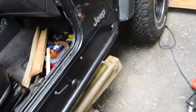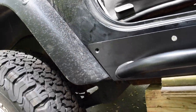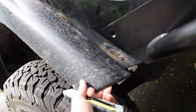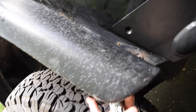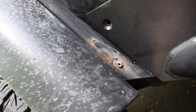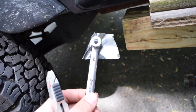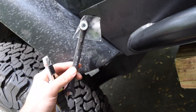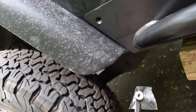I'll tighten the side bolts moderately, then drill on the bottom, then tighten everything up. Here's a helpful hint for getting the last bolt — the fastener on the back: as you saw, I took those two bolts out to move the fender flare. You cut a hole in the tape that's there, then tape the fastener and washer to the half-inch wrench, stick the wrench through the hole from the inside, and fasten it down. That's the easiest way I found to do it.